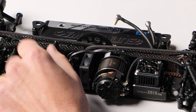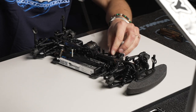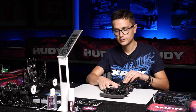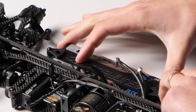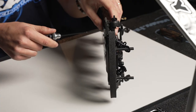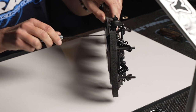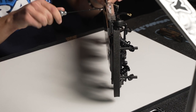We're also going to have a bit of play to the top, so we need to adjust the height of these holders as well to accommodate the height of this battery. I'm gonna turn these until they should not touch the battery but should be very close. So we have a little bit of upward play, a little bit of play front to back, and finally we're going to adjust the play from side to side. As you can see, it's very easy to adjust the play in each direction with the adjustability of these battery mounts, which are included in the kit.